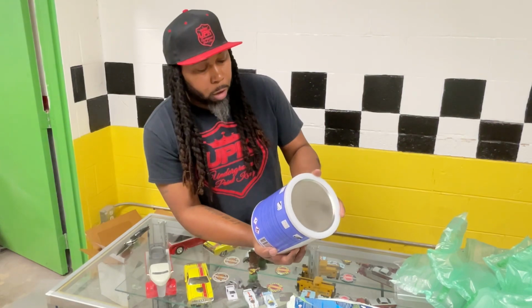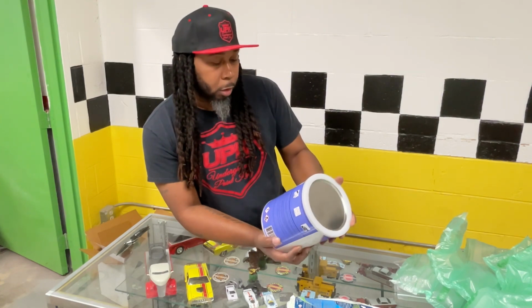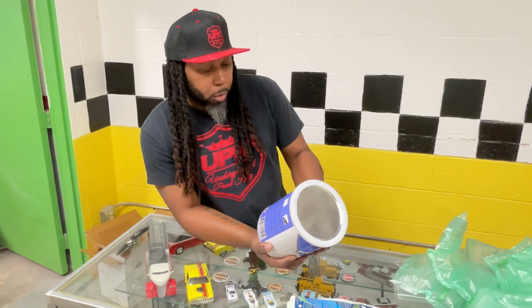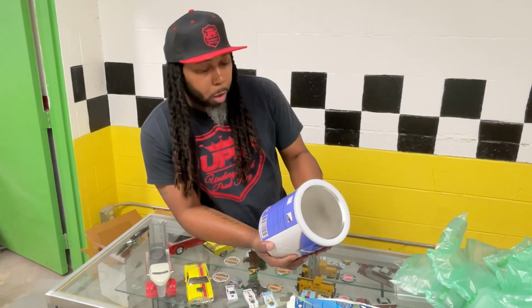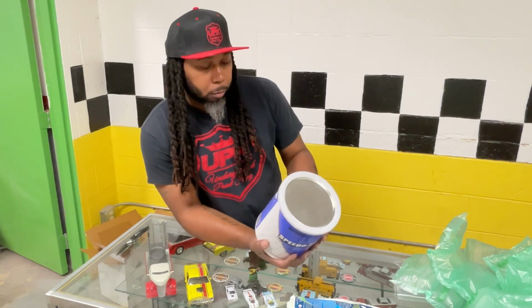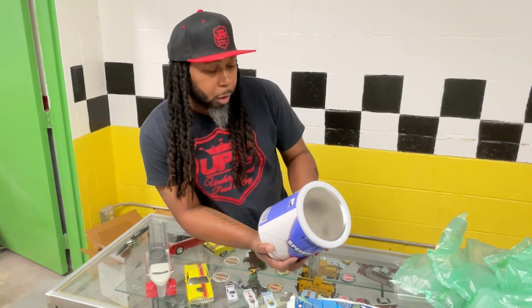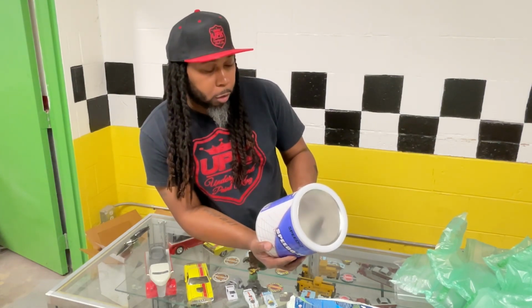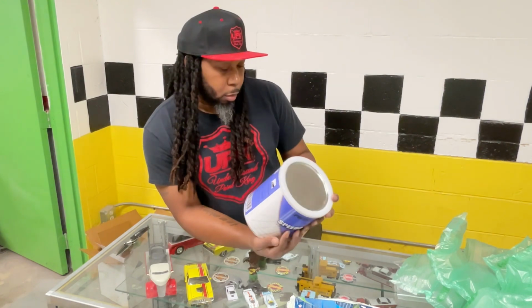It tells you to prep the surface with 40 to 80 grit and a 180 grit feather. Mixing is 2% by weight, 50 to 1 by volume. Says application should be applied in thin layers, no more than a 1/4 of an inch for some of you thick users. They say the dry to sand time is 15 to 20 minutes. And when it comes to sanding, it says to sand with 80 grit to 180 grit.